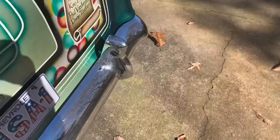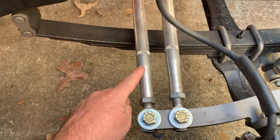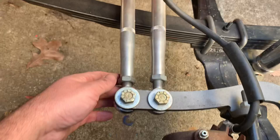Let me go to the other side to show you the steering arms. I got them from a company — I forget the name — but they built me these custom polished aluminum swaged steering arms. You're not going to believe it — these were $15 a piece, polished like chrome when you get them. These are about 10 years old now. I put good heim joints in the ends — you don't want anything junk in the steering.